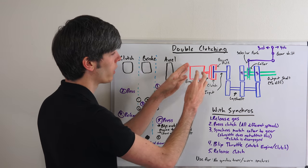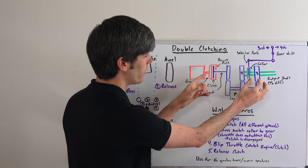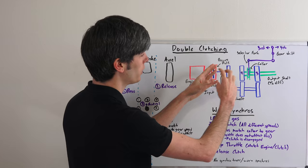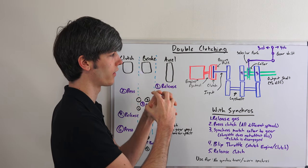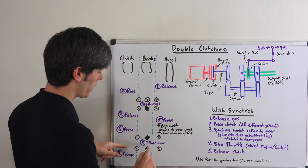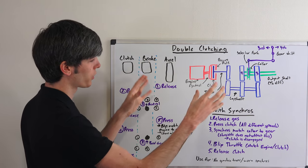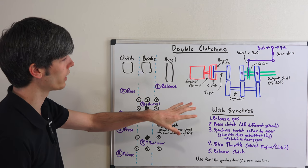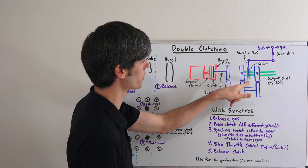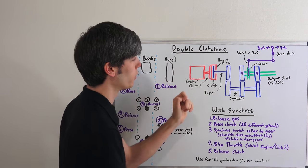We blip the throttle to bring the third gear up to speed with the collar. Once those two speeds are close, we press in the clutch — we do this because we don't want the full mass of the engine influencing the gear shift. With the clutch pressed in, the gear and collar are at relatively the same speed, so there's not much mass to bring together. We connect those, then release the clutch. So the reason you let out the clutch in the middle is to gain control over gear speed versus collar speed, match them, then engage everything smoothly.